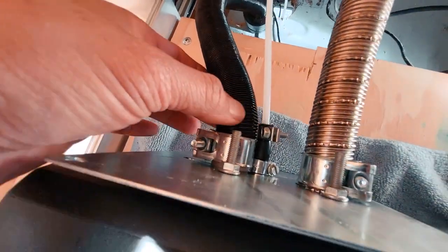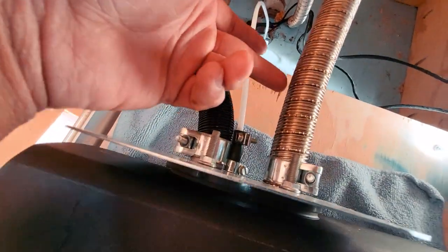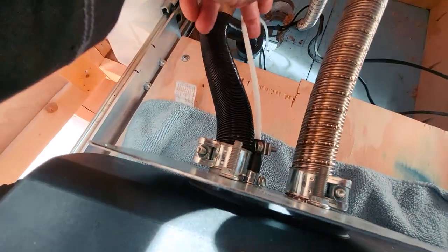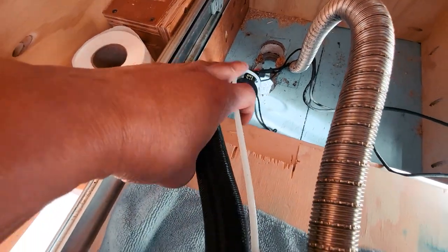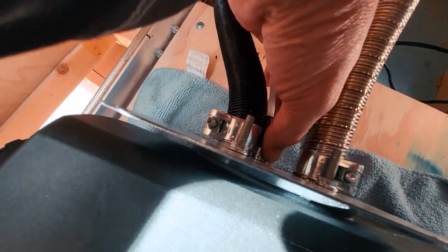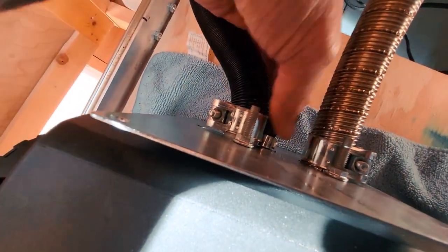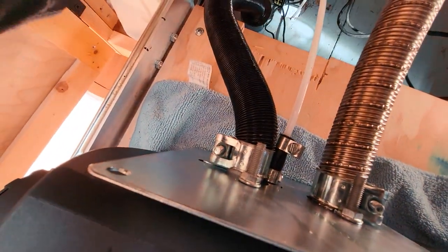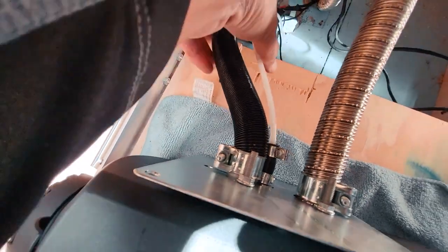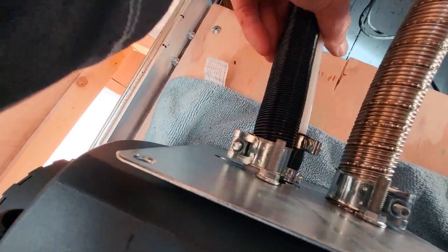But it's crazy how they're so close to each other. So the fuel line is gonna be so close to the exhaust. So you'll have to route this away from this thing, otherwise it's just gonna not work out. And this line has to be nice and clear, no hard turns. Ask me how I know. You want a nice smooth line. If you have to zip tie it somewhere, make sure it's not too kinked.